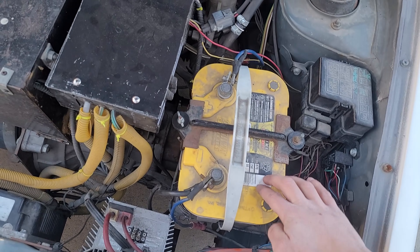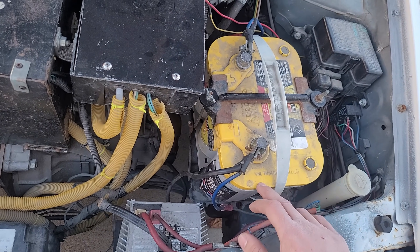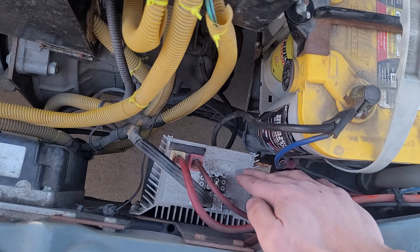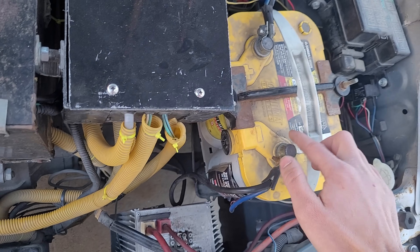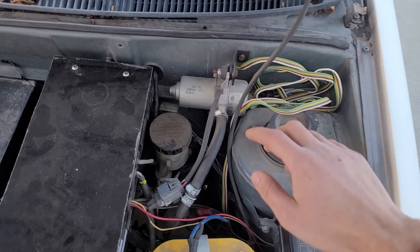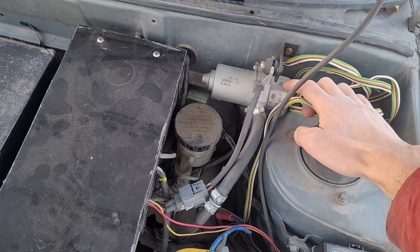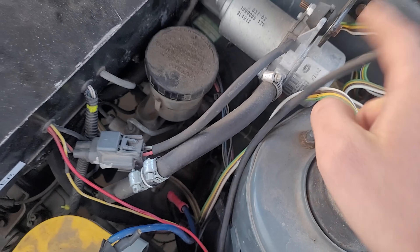Here I've got the original 12 volt battery. It's not turning a starter anymore, so it could be a lot smaller, but it still works — and since it was free it's what's used here. This is the DC-DC converter; it converts the high battery voltage down to 12 volts to charge the 12V battery, so this is essentially the alternator now. And this is an electric brake booster pump. Since there's no more engine to draw vacuum to boost the brakes, that's what this is used for. Down in there is the vacuum chamber for this booster.